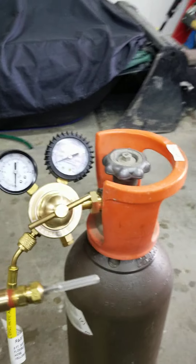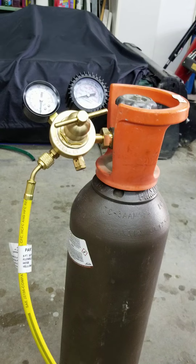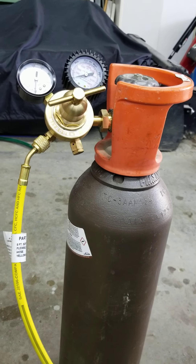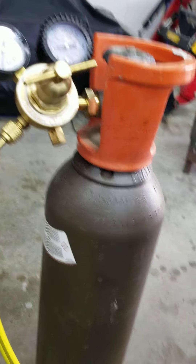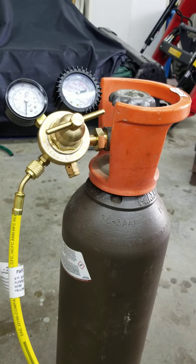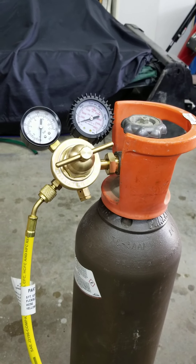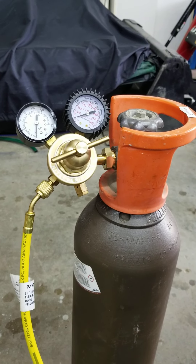The key is I'm a do-it-yourself garage guy. I'm not going to spend a fortune buying nitrogen cylinders when I already have argon — I weld all the time. Argon is a true inert gas. The reason they use nitrogen and not argon to fill shocks is because argon is far more expensive, but I only need about a teaspoon, so the amount is insignificant. It's not worth buying nitrogen when argon is actually an even better gas.